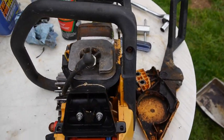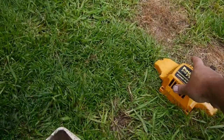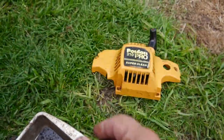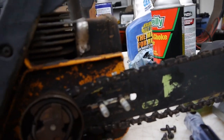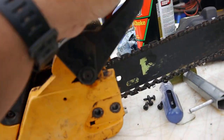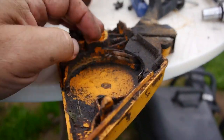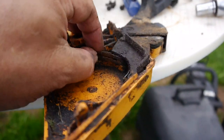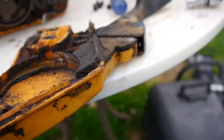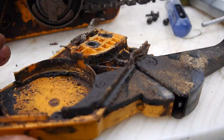I've been cleaning this one off a little bit, it's getting better. I took the cover off and I'm spraying it down — it was pretty caked in there. The biggest thing I could tell was that little kickback safety on it didn't seem to be doing anything. And sure enough, if you look at the little band right here, it's just worn off. This piece is about to pop off — that little ring that goes all the way around and stops the clutch — it's a goner.